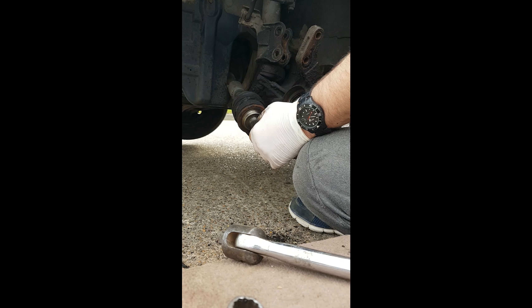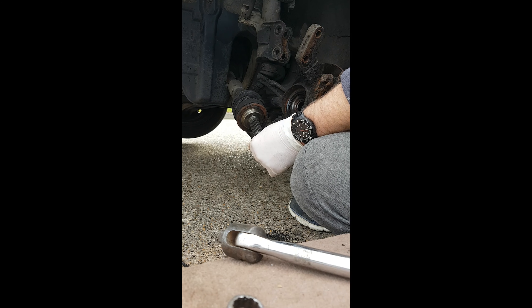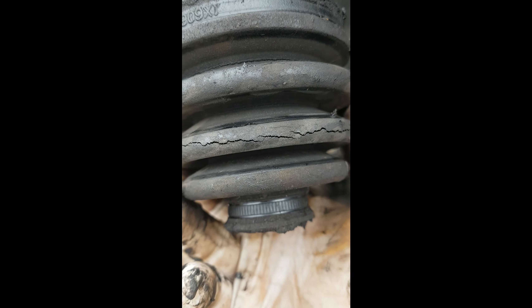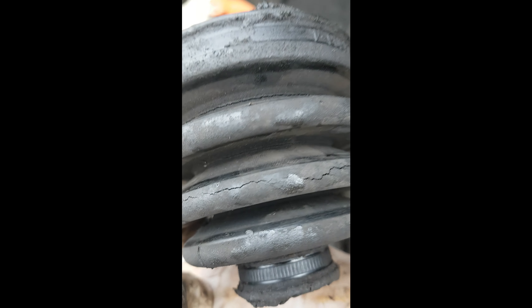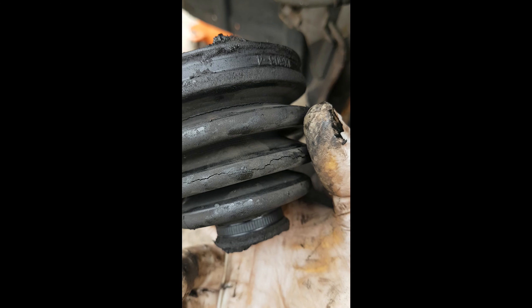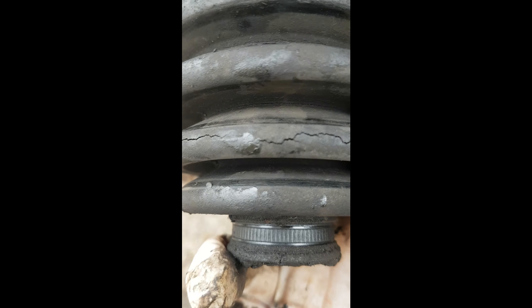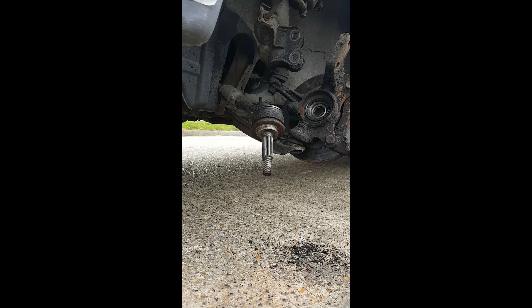The way I'm doing it is probably the cheapest — I'm not taking the oil out, not changing the driveshaft, just changing the boot. We've got this perished, deteriorated CV boot off; you can see it's all cracked on the second bit up from the bottom. There's a little wet patch where the grease was getting out — that's where the MOT inspector put down a minor fault, which I thought was a bit harsh. But obviously every MOT inspector's different.